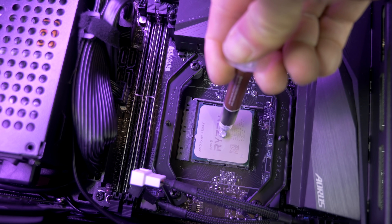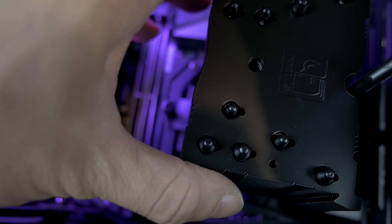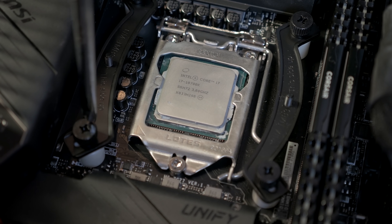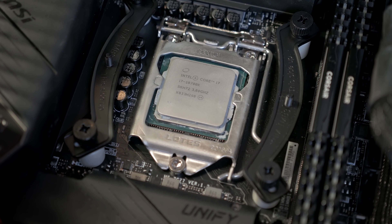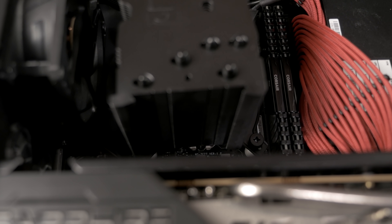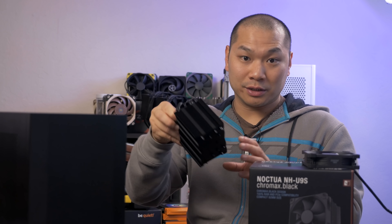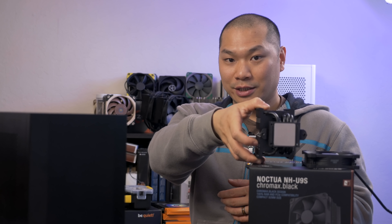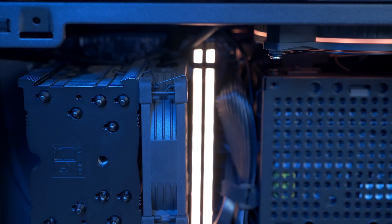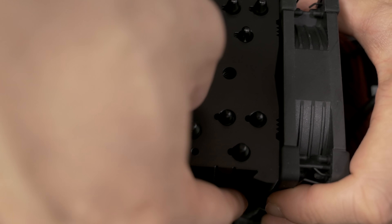Installation is straightforward and exactly what you'd expect from Secufirm 2. For AM4, mounting bars attach to the stock backplate over spacers, then the cooler is placed atop the bars and the mounting nuts are threaded on. For Intel, the included backplate is used, then spacers are placed over the standoffs, over which mounting bars are installed by threading nuts over the standoffs. The tower is offset to one side — it's not symmetrical — and that's to allow for RAM clearance. For most mini-ITX builds, it's a good idea to offset the tower closer towards the end of the case. You just thread the heatsink on, then clip the fan on.